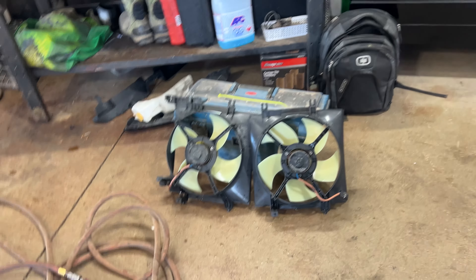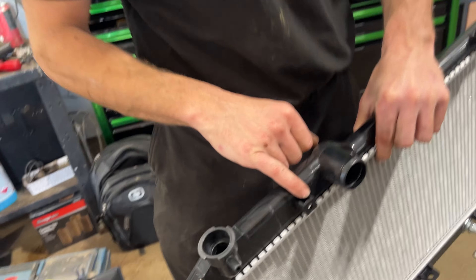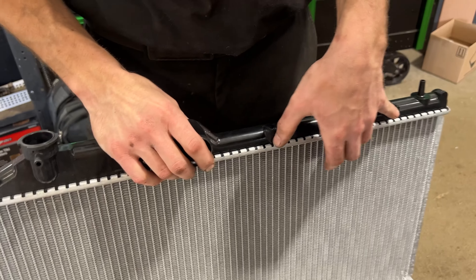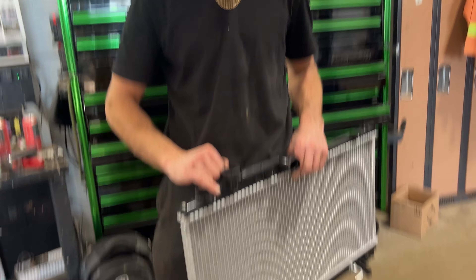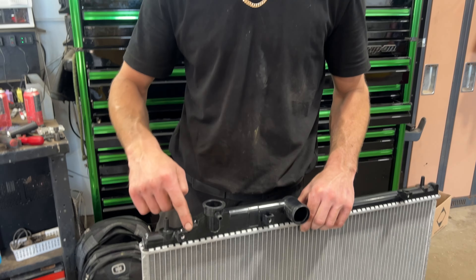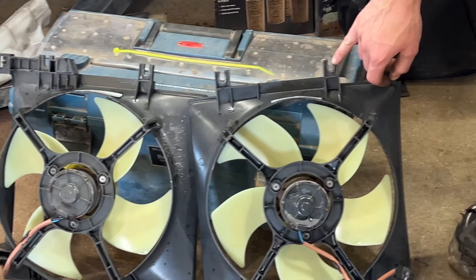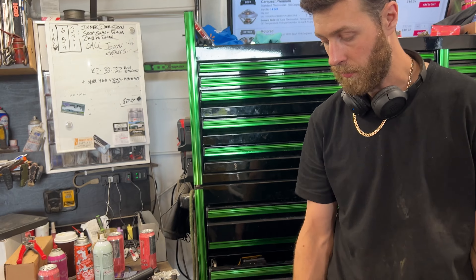The rad fans were another issue — there are little square nuts that are part of the radiator and sit at the very top, four of them in total, and that's what the rad fan bolts to. They get really rusty, and when you go to take off the 10 millimeter bolts, it breaks the plastic and the nut just spins. Since you're replacing the rad, I recommend just taking side cutters and cutting those plastic ears off that have the nut in them. Once you get the rad fans out you can loosen them a little bit — the fans are slotted so once loosened, you can take the piece out and hold one side with vice grips while you undo the other side.